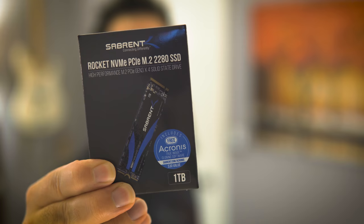For storage I went with the Sabrent Rocket NVMe PCIe M.2 2280 SSD — one terabyte. Some of you might ask why PCIe 3 instead of 4. I did some research and it doesn't seem like what I'm doing would really benefit from PCIe 4. That PCIe 4 technology for M.2s is still pretty new, clocking in around 5 GB/s read/write, and PCIe 4 spec is around 7 GB/s.